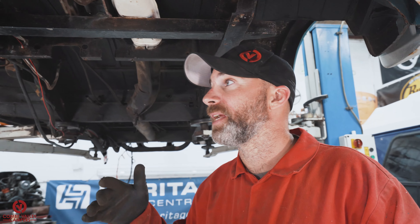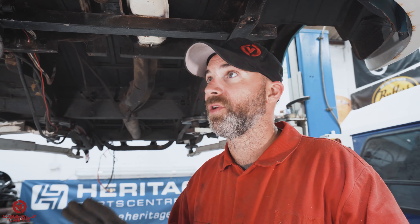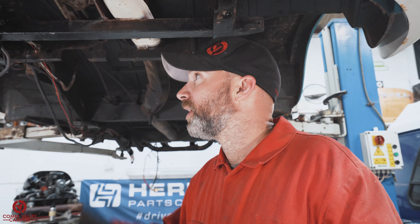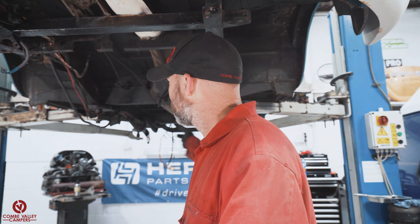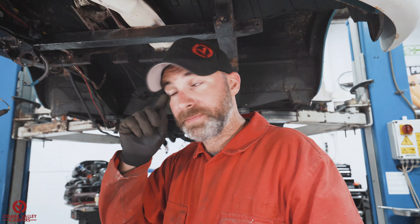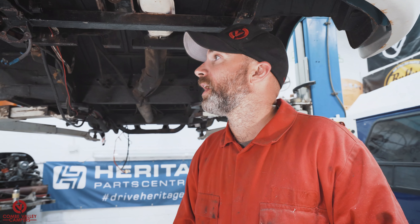This is, like I've said, a dirty job. If you get overspray on any of the bodywork, that's not a problem because you can use brake cleaner or a panel wipe to get that off. However, the more you can do to prevent that from happening makes for an easier job afterwards. Once we're blowing it down, we're going to cover up pretty much everything in the workshop that is precious, then make basically a skirt around here, weighed out with maybe a battery or a wheel so it doesn't blow inwards. Mask back on, goggles back on, I'll get the compressor out and blow this down.